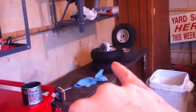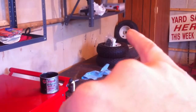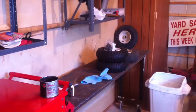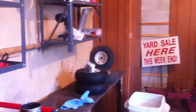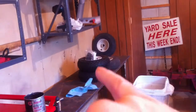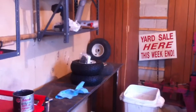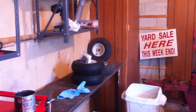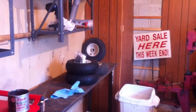So I was going to put those tires on — remember I bought the big expensive ones? Well those little tires over there, that inside part that fits on the axle, that little round part in the middle of the rim — on these little tires it's really wide. When I try to put that on the trailer it turns out it's just too wide, and there's no place to put my cotter pin to hold that thing on because it sticks out over the end.